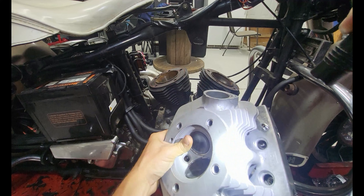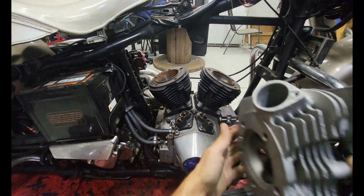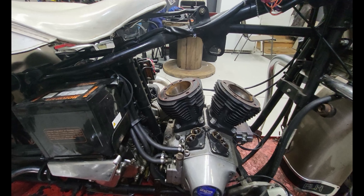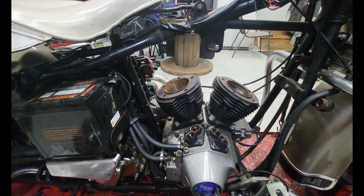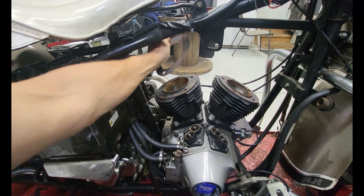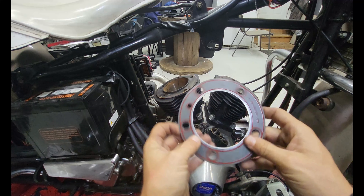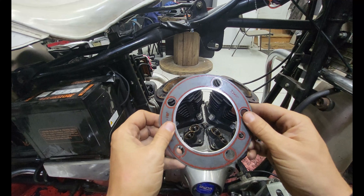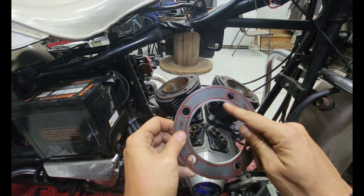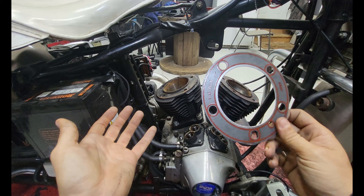Lifters are back here - they're still good. Just beautiful. When you get to this point, chances are you're going to have a shitty blue Garlock head gasket. Those work - you might be replacing it with that. What I like to use are these Genuine James gaskets. But if you get the Genuine James with the RTV and the fire rings - this piece here is called a fire ring, it compresses - and if you've got a higher compression motor or even just a stock motor and you actually ride your motorcycle, these are great to have.